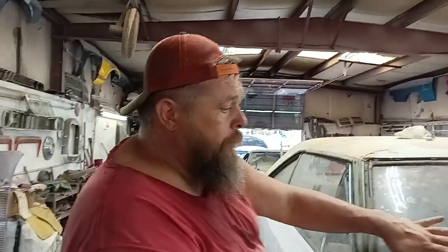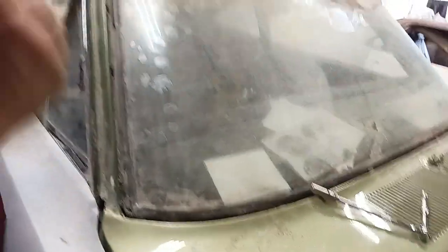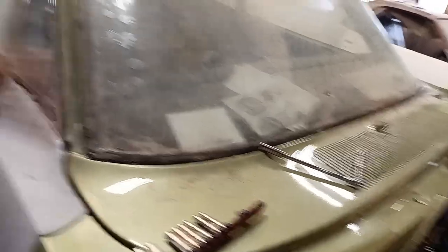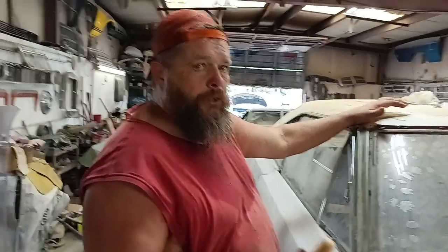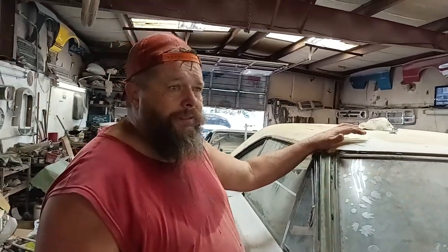What I'm going to do on this car — and what I recommend — is that on a lot of these old garage-kept cars, I used to come up with my knife, stab it in right there, cut the rubber off, set the glass out, get new glass, get new rubber, and then fight and fight trying to get that new rubber to fit. They don't work. So if you have to buy one, get ready to fight.